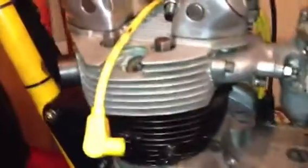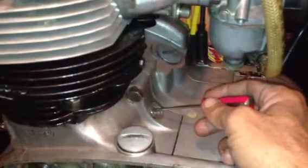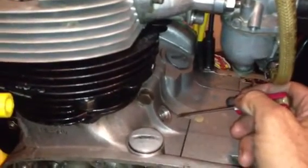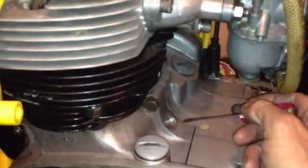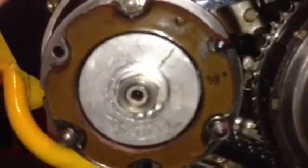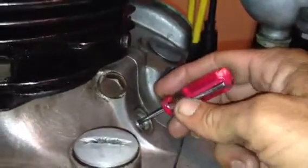This is a '72 motor and the timing plug is located right here. Now on the crankshaft there's a little notch to let you know where top dead center is. Triumph makes a tool, but you can also use a little screwdriver here. I've already marked my alternator top dead center and 38 degrees before top dead center with the timing wheel. We're gonna stick a little screwdriver in.